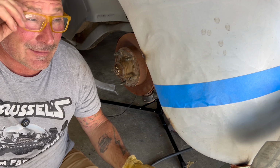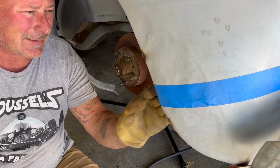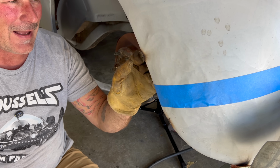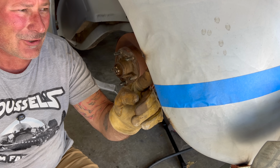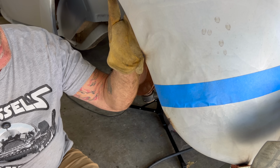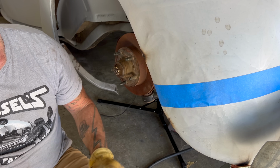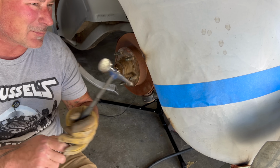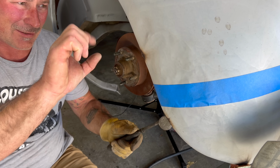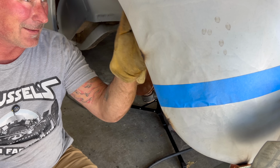So I was just thinking while I was doing that, it might seem counterintuitive to weld these flexible pieces in place. But in fact, you're getting control over this edge and you can push this sheet metal out. So yeah, it looks like all this. Maybe I'm just going to wallop that with the hammer just to see what happens. See if I can, now that this is welded, see there's some rigidity in here and you can stretch it instead of it just opening. And that totally just moved out.